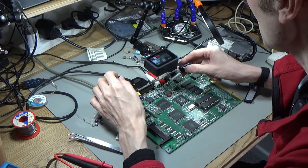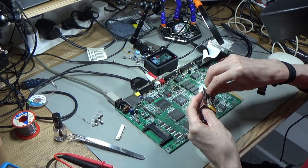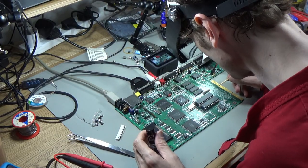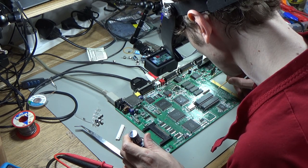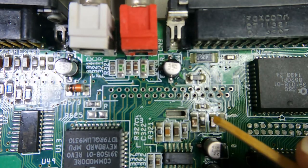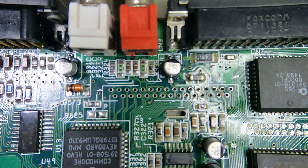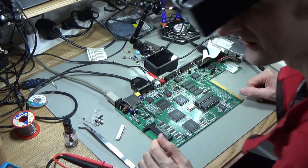The trouble is the brush on this is massive, so I'm just going to get a tiny bit on there. I've got an old box of matchsticks — safety matches. Maybe I could just get it on with a match, that might be the way to do it. I just want to cover that up and stop it from corroding, or from any solder getting on it when I resolder the keyboard connector. It is very close to those keyboard connectors. So I'm just going to dip a bit on some tin foil. Oh, it smells really bad. There's a little bit on the end of this matchstick. There we go — that's a very smelly Amiga 1200. That stuff's really potent. So there's not much to see there, just a bit of nail lacquer.